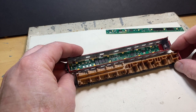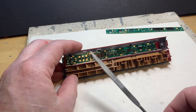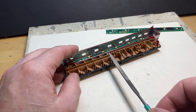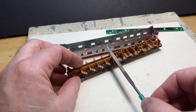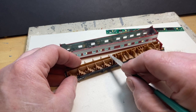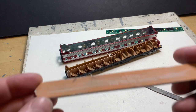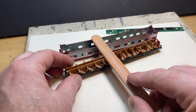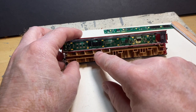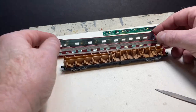What we're going to do is align the car and take our file and file down approximately here — just flatten this section out. We used to use a grinder but it doesn't work as well, so we'll do some filing, down about a millimeter. I'm going to keep this wall and file this partition down about the width of the file. A women's nail file is great — this is a fine tooth one. We'll file it down smooth and even over the CPU and also over the regulator, and that should give us a clean install.